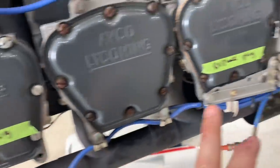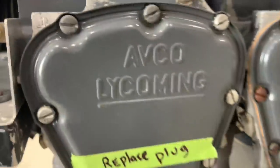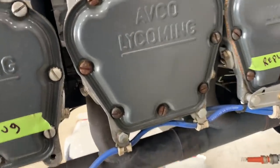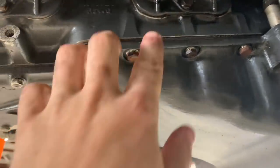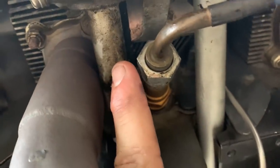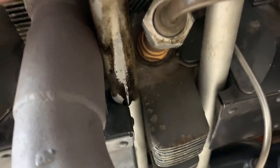Our experienced mechanic went ahead and wrote 'replace plug' on the valve covers — we ordered new ones, but this will also help on the entry so we'll know which ones we replaced. Sometimes things happen so fast and the owners might ask what cylinders did you replace it on. We've also got a pretty good oil leak on this one coming from the seals, and the same leak on this seal as well — that one might actually be coming from the valve cover, probably a little bit of both.